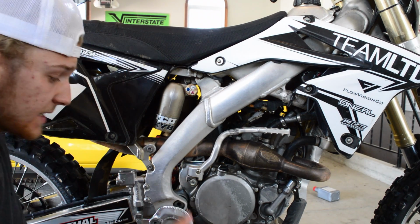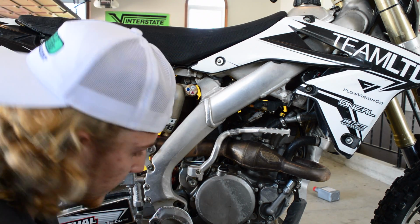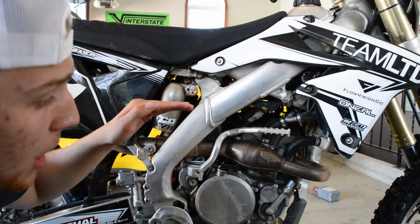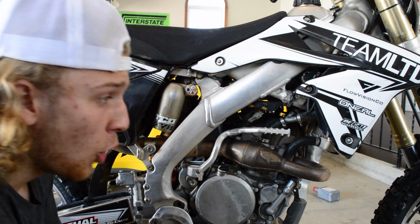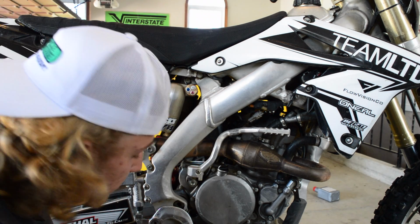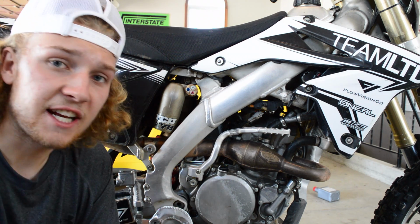After running it for a few minutes, I can tell here that the oil level has decreased from before running it. As it's been cycled through the motor and covered all the components, the oil level sits right at the top of the marker in that little gauge. It's currently at the top of that little marker, so it's totally good. I always rather have it a little over full than under full because, you know, more lubrication the better, in my opinion. Some people might differ, but like I said, the oil capacity is good. It's ready to rock and roll for the season, after it's been washed, oil changed, and air filter done.